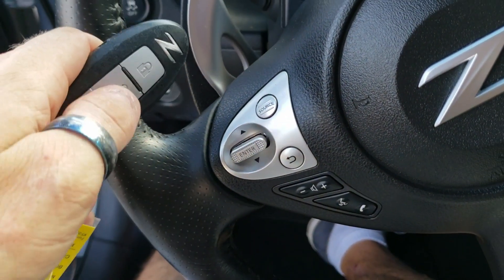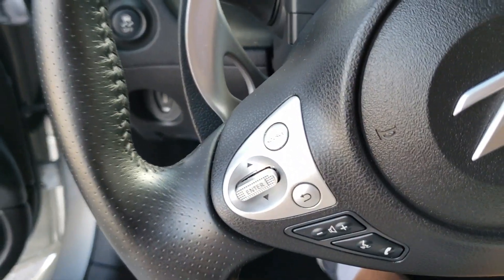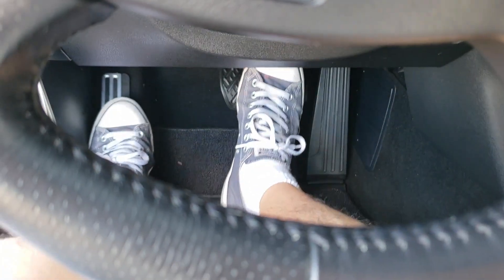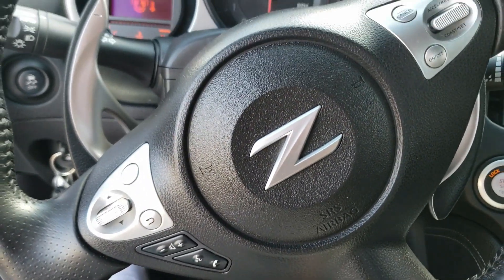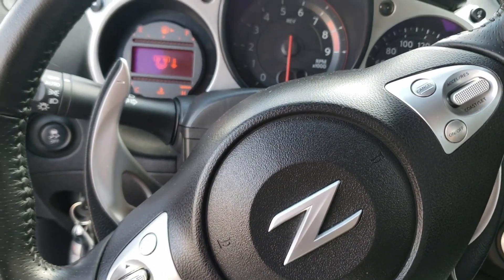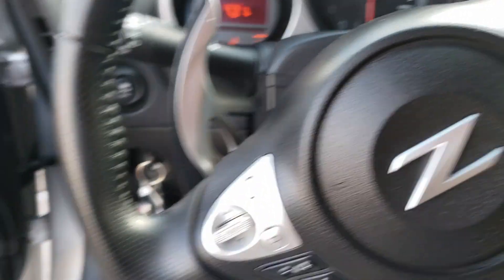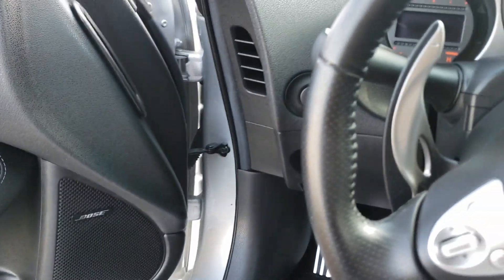What you need to do is push the unlock button on the key fob. The light on the module will start flashing orange. When it does, put the key all the way into the key port. Press the brake for about 15 seconds, or until the green light turns solid on the module and then turns off — it usually takes about 5 to 10 seconds, could take up to 15. Once it's green and off, release the brake and pull the key out. Now we're going to jump out of the car and give you a demo.